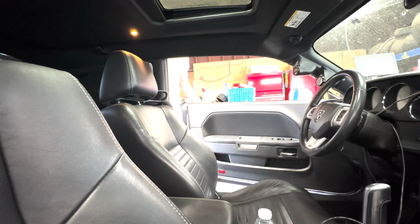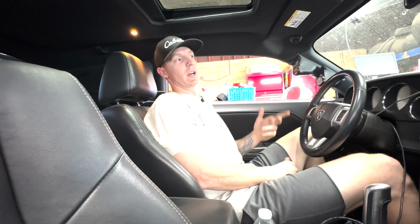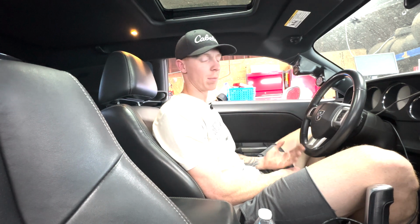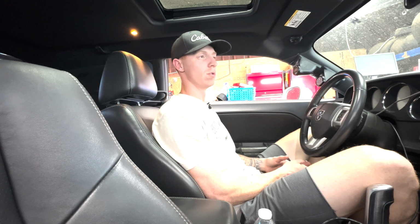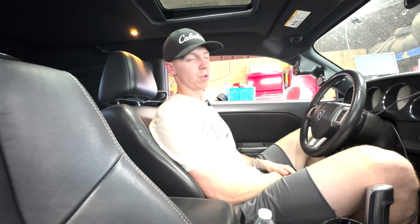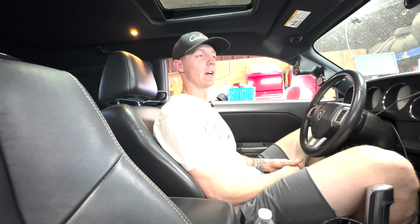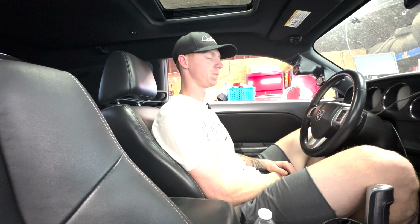All right, so I just wanted to cover really quick one more time the mods on this car. This is basically a shelf cam, which means it's not custom spec'd. It's just a generic cam that'll work for a 5.7 or 6.4. This is a 220, 230 cam from Comp Cams. It's a stage 2. I think the part number is 201-303-17. I think that's the part number for the stage 2 cam. It comes with the springs and everything, phaser limiter.